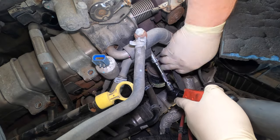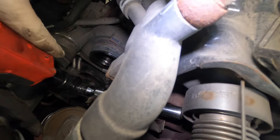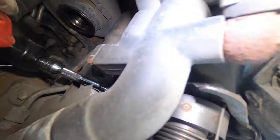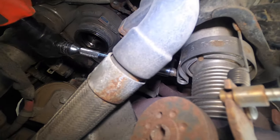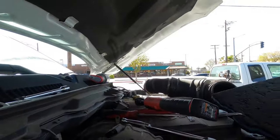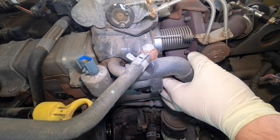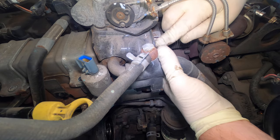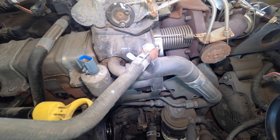Then we're going to go through the bottom right here. I'd like to show you this - see the clamp right here? You don't have to take these all the way loose, but I like to get them really loose just to make it easier so you're not fighting it. Just like the other one - push down on the bolt, pop the bolt out, just like that. Okay, I need a 10mm - now I have my swivel so we're going to get this 10 out right here.